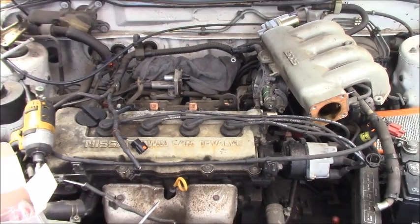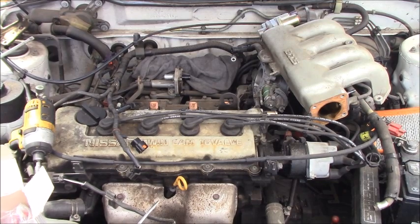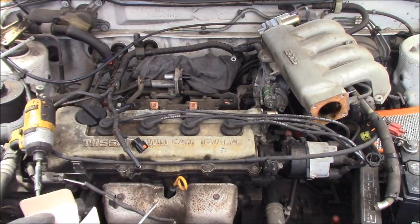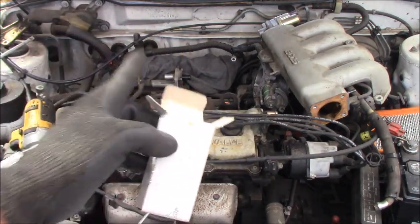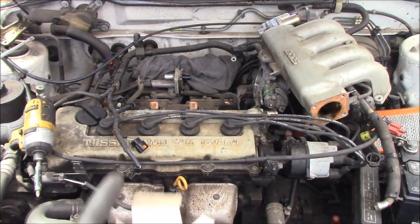If you put them in without measuring anything, just believing the new parts, and then later it misfires again, you check and find, oh yeah, a bad new fuel injector, then you have to start over, remove everything again. You will be fed up, okay?